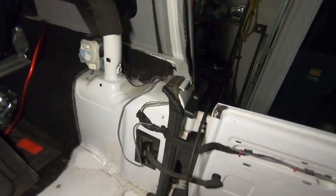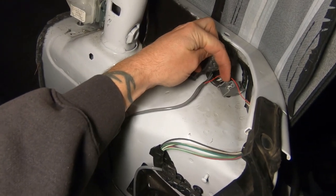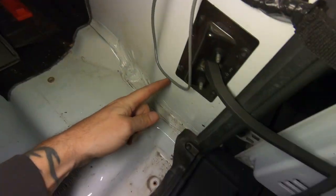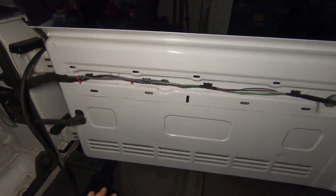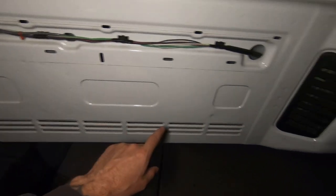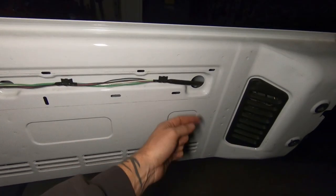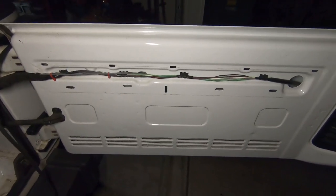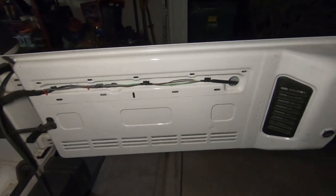Bear with me — poor lighting conditions, just like any other guy in his garage. So you can see where the sub was; all I basically have is the inertia reel for the seatbelt. Here's the connection that was for the sub itself, and here's my wire I ran for the license plate light. So what I'm going to do is mount the subwoofer on the tailgate here using nutserts — probably put one here, here, here, and here. I'll pull the sub out of the box, bolt the subwoofer from the inside of the box onto the tailgate, then reinstall the subwoofer. There are no bolts visible from the outside, and if somebody wanted to steal it they'd have to take the entire tailgate or take the time to take the box apart.